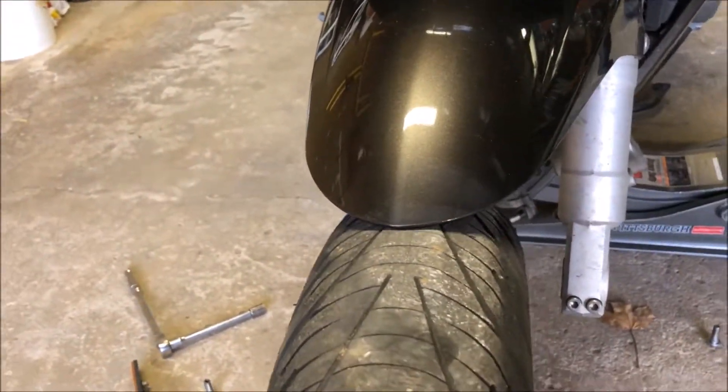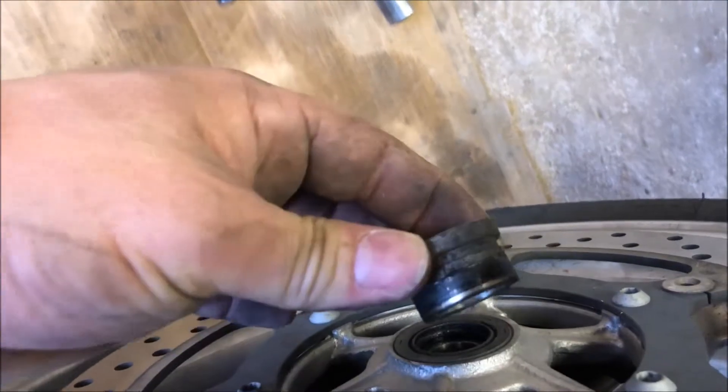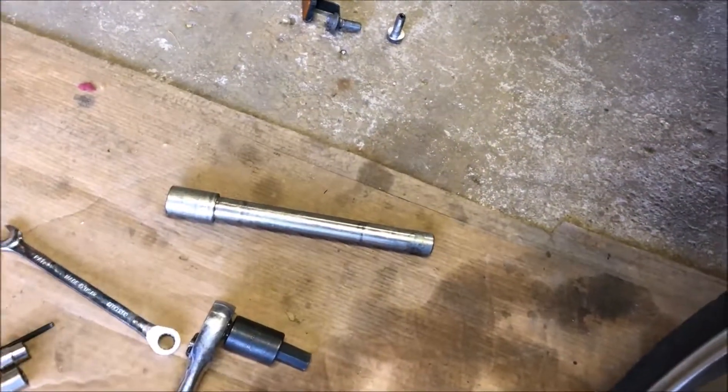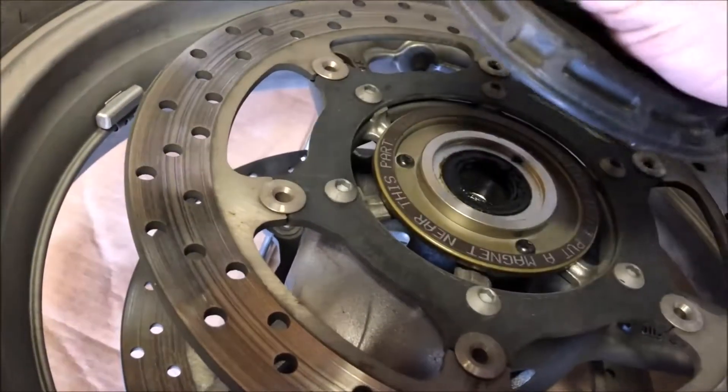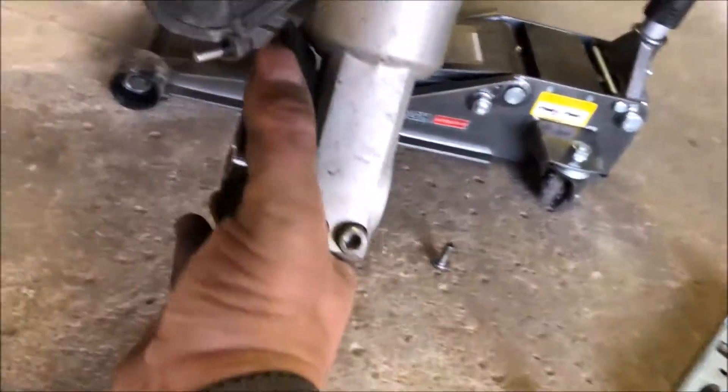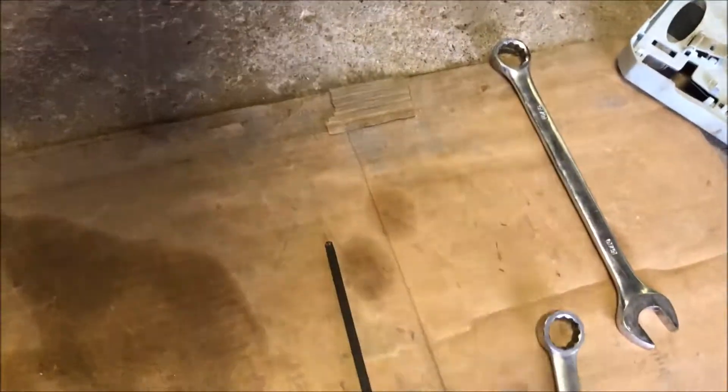Got the tire off. Notice I had to angle it — make sure you angle it out, otherwise you'd need to take the fender off. On this side there's a washer and a spacer — it'll come out. I don't bring this to the tire shop when I have them change my tires; I leave it out and put it on the axle. I'll also take the ABS sensor part off — just like on the rear, this ABS sensor has a little slot that has to match up right in here, so when it goes back in it'll be in the right spot.